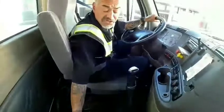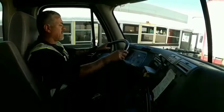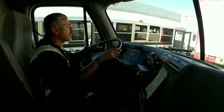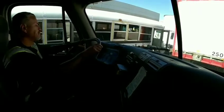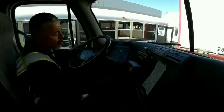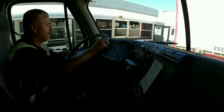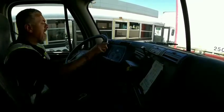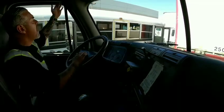I have three emergency triangles under my passenger seat — they should not be cracked, not missing, with no discoloration. My fuses and circuit breakers are in my left side engine compartment; I make sure I have spares. My right signal turns on and off, left signal turns on and off, my four-way flashers turn on and off. My headlights low beam turn on and off, my high beams turn on and off. This is my city horn, this is my highway horn — working properly.